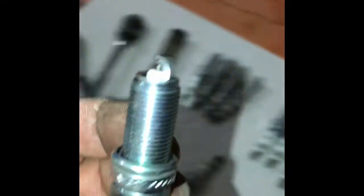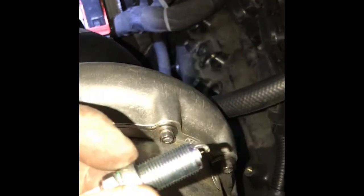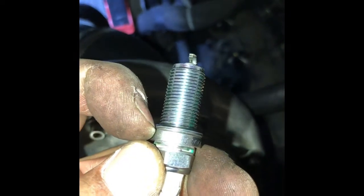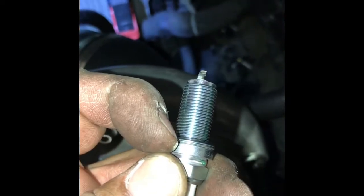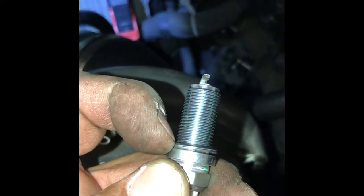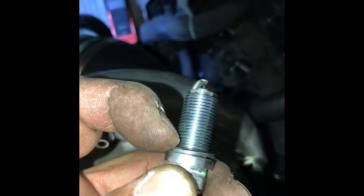These spark plugs have compression rings, compression washers. You don't want to crank it too much in an aluminum head, because if you do, you're gonna be doing head work if you're too tight. They won't come out. Aluminum likes to expand and contract, and aluminum also likes to corrode. So these rings are designed to compress a little bit, and you give it about an 1/8 turn, you know, tight, not too tight, but tight. So it's sealed, it seats and seals.